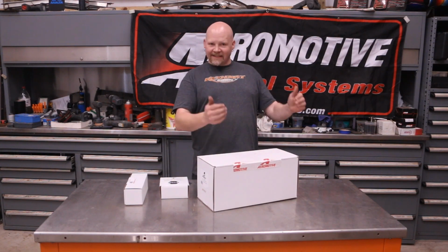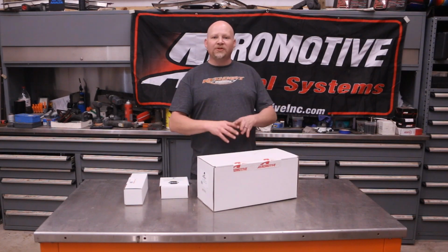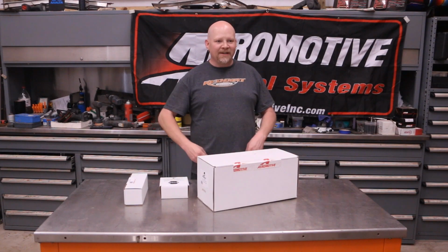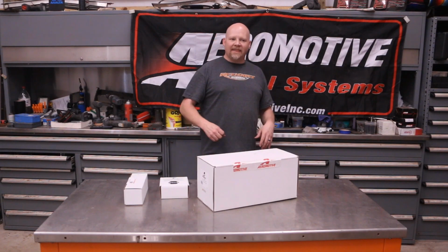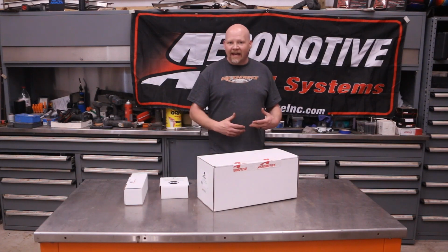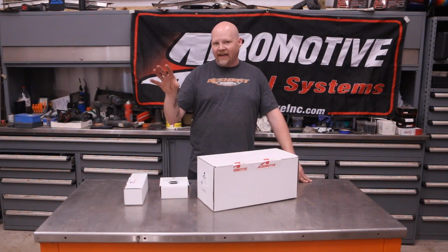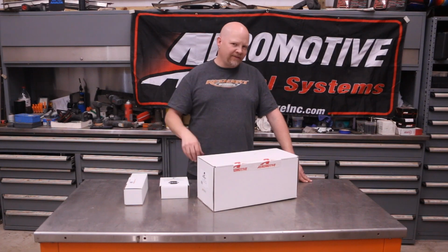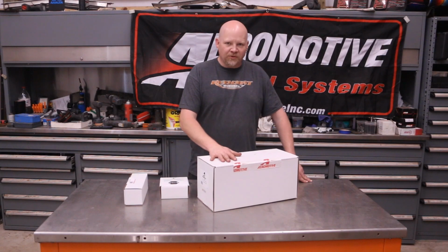Unfortunately, it has not been driven in a number of years for several reasons, mostly related to the LT swap, because we put the LT in it, we put a 4L65 in it, and then we added a ProCharger, and that caused a bunch of problems, so we had to put in a TCI Super Street Fighter 4L65, and we actually have a 12-bolt rear end that we're building for this car, but we haven't got it put in yet. So one of the things that we're doing is upgrading the fuel system.